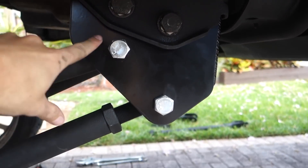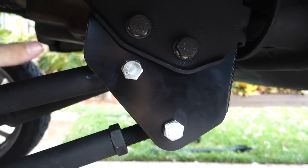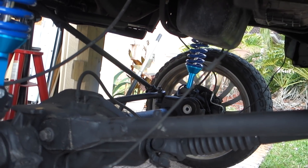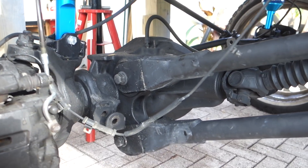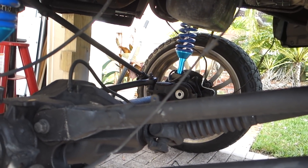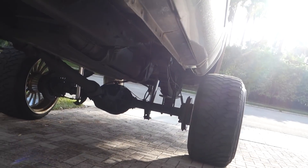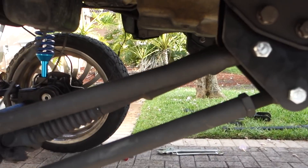I just threw in these nice, pretty, brand-new bolts here, and I used the old ones up top. They're just hand-tight right now — same thing with those, hand-tight for now until I get the other side in and then I can drop it. The main thing is I want to have the weight on the truck before I tighten anything — that's usually the rule of thumb for suspension. Then once I get these bars in, I can go ahead and realign the track bar, realign the drag link if it needs it, and make sure everything is tight. Then I'm going to measure and make sure my truck's not crab-walking, because Fern told me it was a little bit and I really don't like that at all.